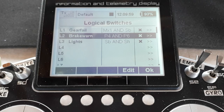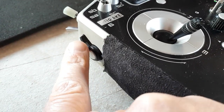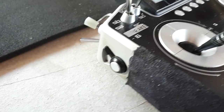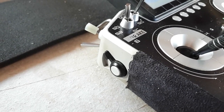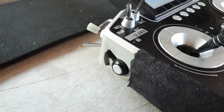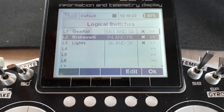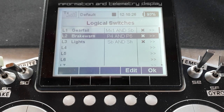Brake warning — nice and simple. I use the side slider here as my brake controller. Air brakes — pneumatic brakes don't work particularly proportionally, but I've got a nice proportional valve in the plane, and that's where I've become used to using it with my left finger. It did occur to me that it could get knocked in flight and switched on, and without realizing it I could come into land and have brakes on — finger goes to the brake lever but the wheels are already locked up as it touches down.